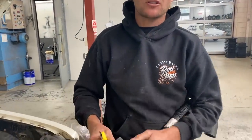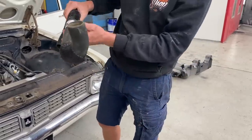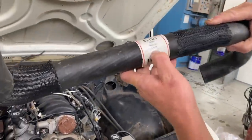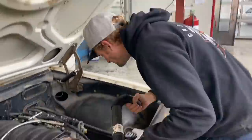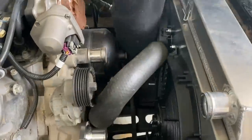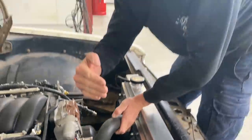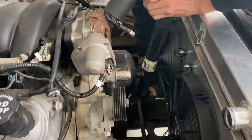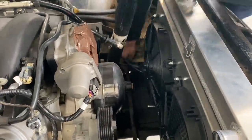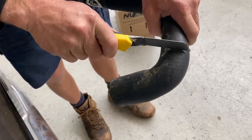My big setup here — I'm not going to put any hose clamps on yet, I'll do all that at the end. Let's just trial and get everything right. This is a Ford Falcon AU V8 hose — there's the hose number. When you cut it, cut it to the furthest point, try it on there — you can always cut back, we can't add on. We'll cut down near the bend there somewhere, obviously cutting away from the body.